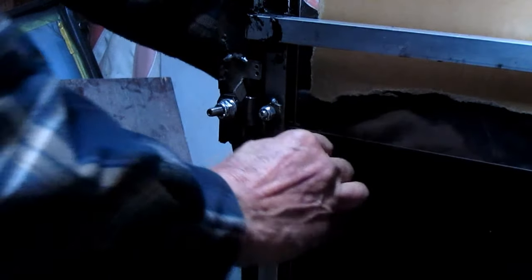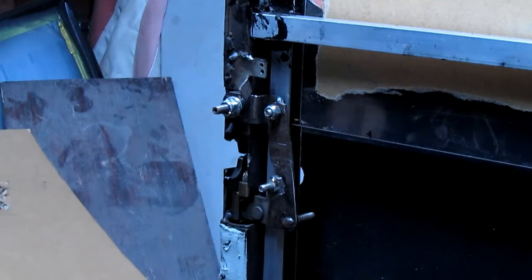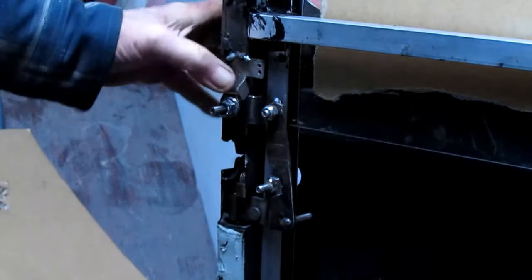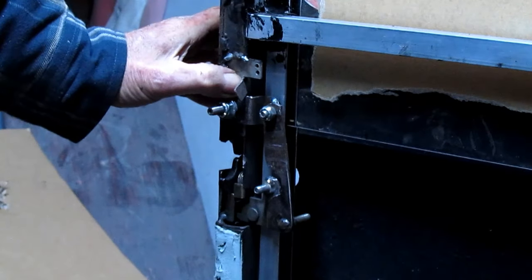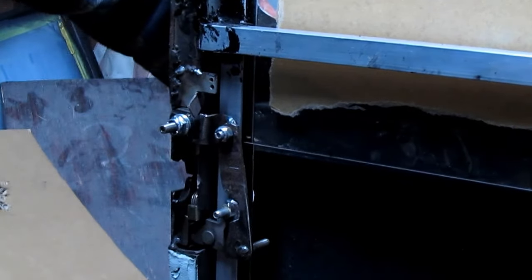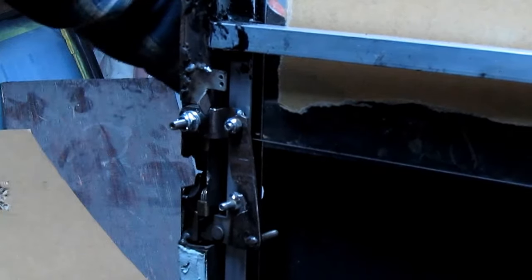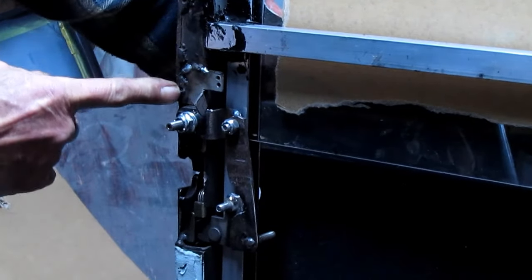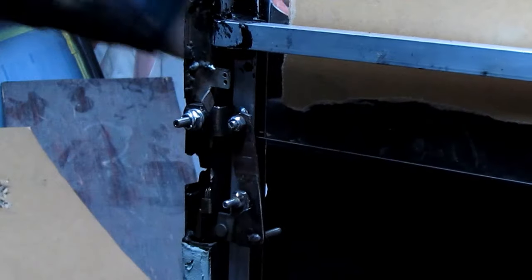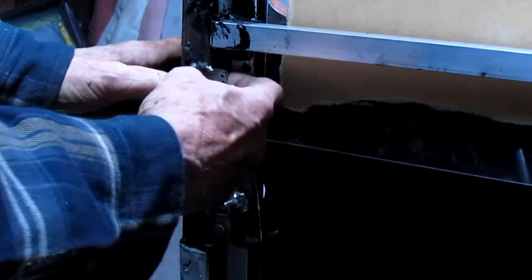I've got to cut this one off because the window won't go down. The latch now is all inside the door. I'm going to change this stop a little bit here — I need to get it where it's level, which is about right there. So I've got to lower it about an eighth of an inch. I'm just going to cut this plate off and grind it down, and probably just weld another small plate right here for a stop. I'm going to take the plate this way so it's all inside the door — I don't need anything sticking out. So I'll just put a plate along the front to back of the car.